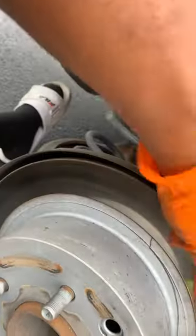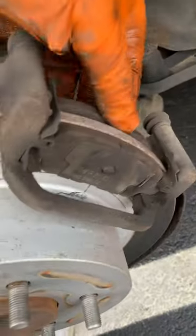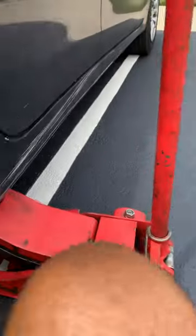So we're on the passenger side. You can see the smoothness of these pads — I ain't catching them yet, but it's there. These pads over here are much more intact; they have a little bit more meat on them. So we're going to still swap them out with the new ones and then we're going to finish up.